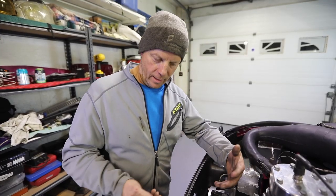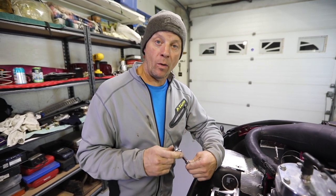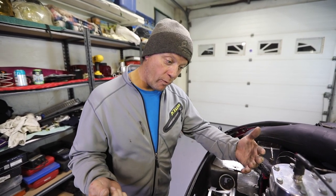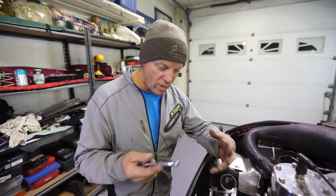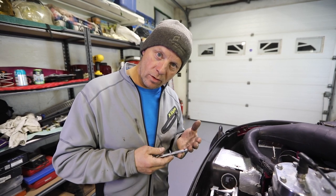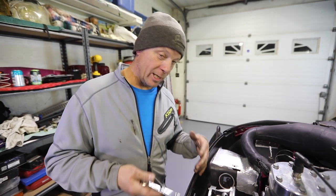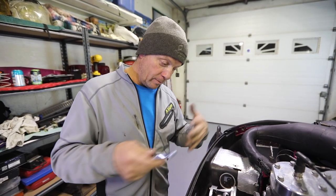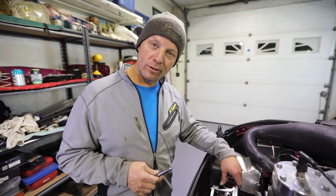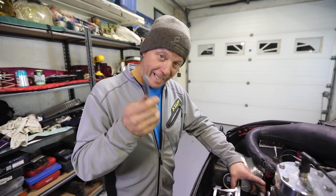When you get into the mod sled thing or you want to improve something on your sled — let's say you want more power — you have to change the clutching. A lot of times that involves a bunch of stuff. The phrase 'clutching is a black art' is true. Everybody has a little different theory on how to set it up, and there's many different combinations. You start with springs, clutch weights, and gearing in the chain case — that all affects how the sled is going to work. It's all in the combination.